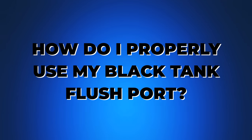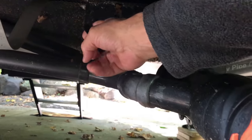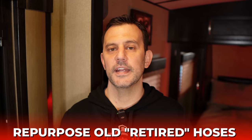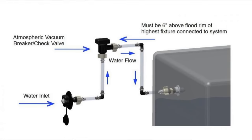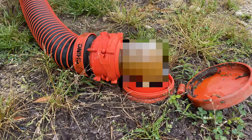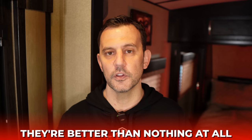Another question we get a lot: how do I use my black tank flush port? It's a pretty simple process. First, your black tank needs to be empty because the sprayer on the inside needs to hit the walls, and that won't happen if there's water in the tank. Make sure you're connected to a sewer and your black tank drain valve is open. Just connect the hose to the flush port and turn it on. It's a good idea to have a separate hose for your black tank flush port — however, there are check valves and vacuum breakers between where you connect the hose and the inside of the tank, so you shouldn't have any backflow contaminating your drinking water hose. After you turn the water on, monitor the water flow at your clear elbow — it'll probably be milky brown for a bit, and once it starts to clear up, you're done. These flush ports are not high pressure water jets, but they do a pretty good job rinsing the interior walls.